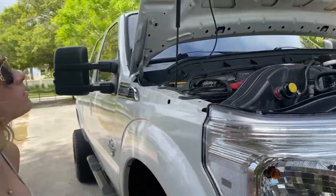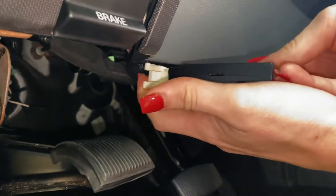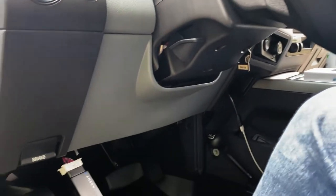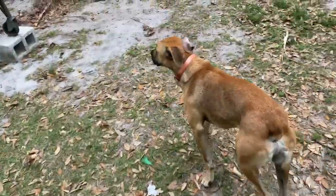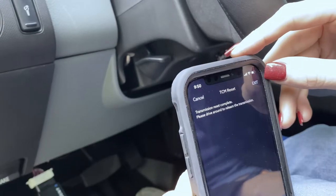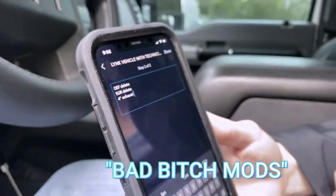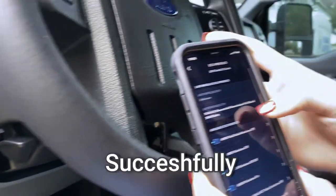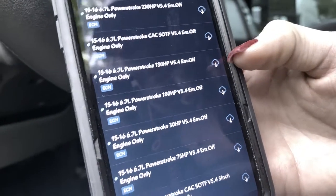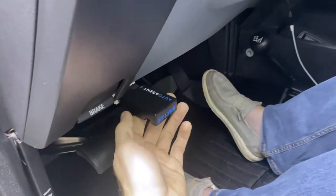With this Easy Link you get TCM and ECM tunes. You're going to reset TCM under the functions tab. I had to go to ECU profiles, put in the technician's email and the description of the truck. For the TCM they told her to go with the v4.5 raised shift points. Transmission installed successfully. We're going to start with the 130 v5.4, emissions off, engine only. We've had quite an issue having to keep going back to the WiFi because it keeps disconnecting for some reason.